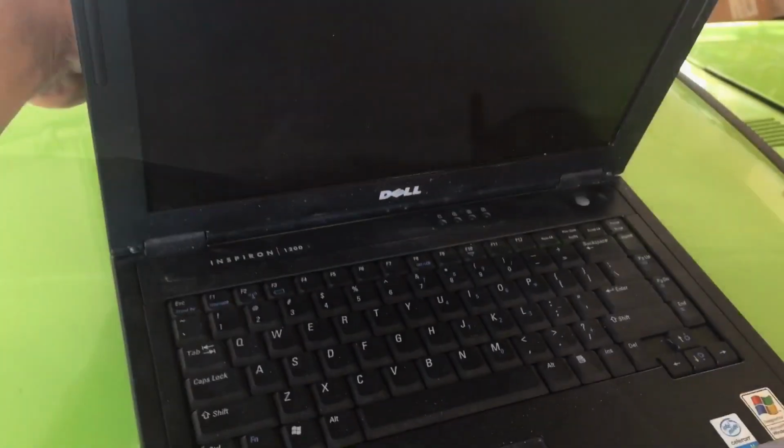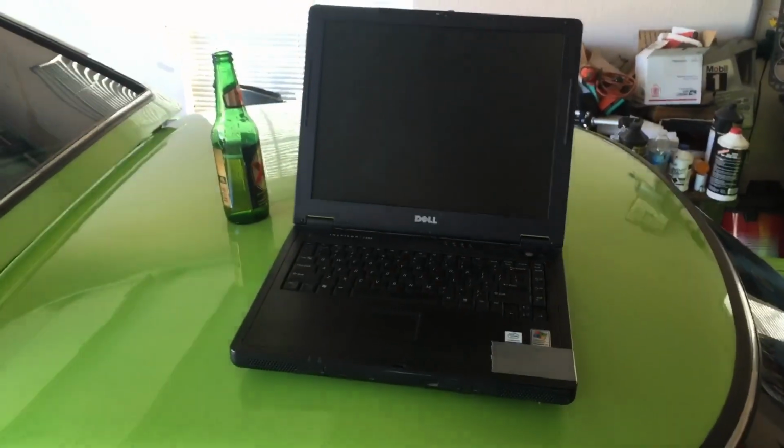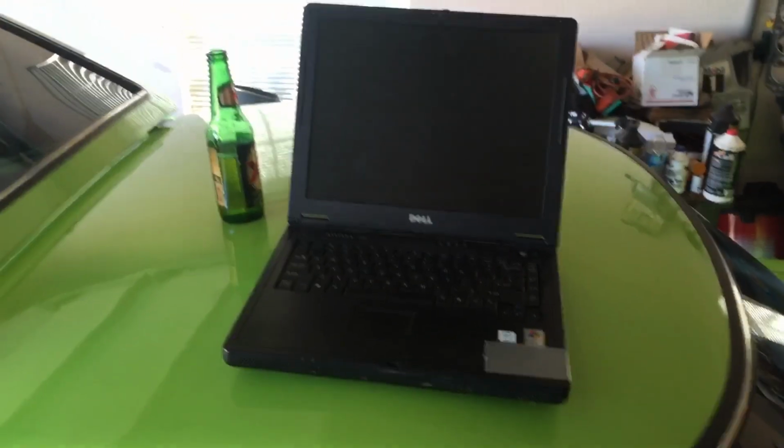I think I needed to put a little fuel in there. The data log reads consistent, about 11.5. I had some major wheel spin. So this is my POS laptop, and I'll show you how I hook it into my Haltech, and we'll just give it just a tad more fuel.